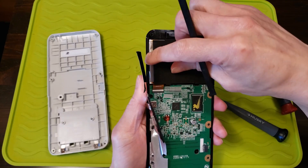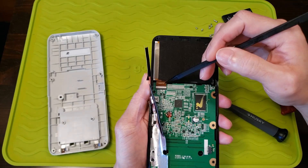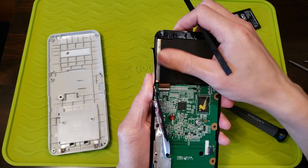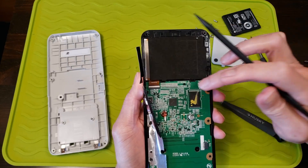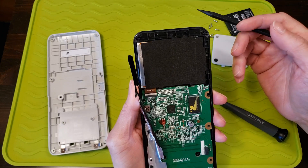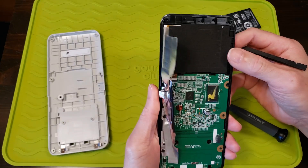Here's the LCD. It's attached to the board via this ZIF cable — zero insertion force cable — so it's not glued down, like on the TI-83 or TI-82 where the cable is glued to the LCD and the board via a conductive adhesive. Pretty neat. I like looking at this stuff.